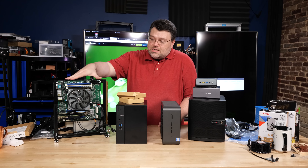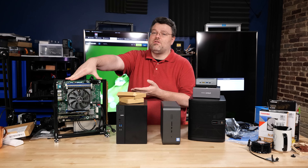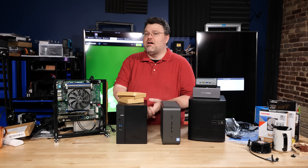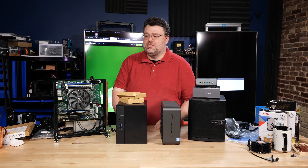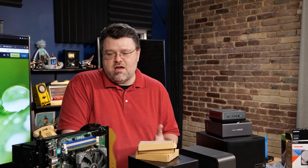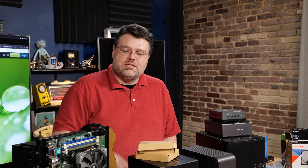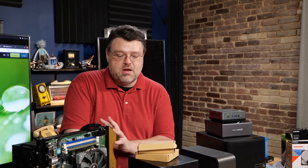For the last several years, running AM4 for your home server solution has been quiet — it doesn't produce a lot of heat, doesn't get hot. It is awesome. It's a little bit DIY because those Dell small form factor systems aren't built around AM4, and the ones that are typically limit to a 65-watt TDP CPU. So a 5900 no-X would work at 12 cores, but the 5950X — forget it. The Scythe cooler I've got on this and the rest of the system — I'm really happy with this open-air setup.